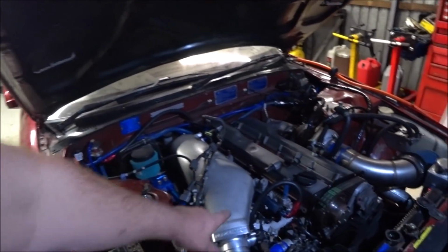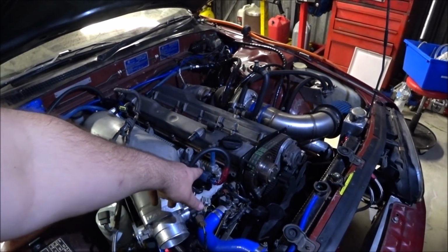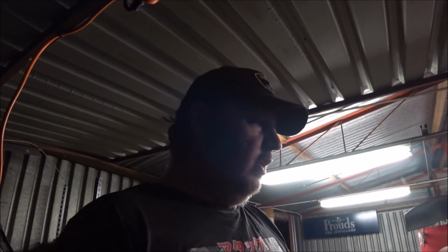And what it was, was a low voltage. It was because of all the other stuff I'd done with the jump pack on. The jump pack had more than enough to turn it over, but there's a minimum voltage requirement when you're turning over for the injectors to even fire. Something like 9.7 volts or something like that. It's written down somewhere in SAU forums, you'll find it. That was like 1 o'clock in the morning when I found that.